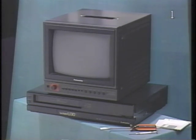To complete this course, you'll need these additional materials, tools, and equipment. You'll need the Macintosh Portable Technical Procedures, the Macintosh Portable AppleCat Mac Test Diagnostic Diskette, and the Macintosh Hard Disk Test Version 1.0 or higher. The Macintosh Portable requires very few tools to service it, but you will need a number 2 screwdriver and a jeweler's screwdriver and an ESD workstation. You'll also need this equipment: a Macintosh Portable, a printer, either an ImageWriter or a LaserWriter, to print the completion card on, and a videotape player and monitor.